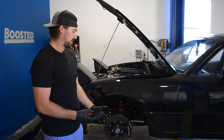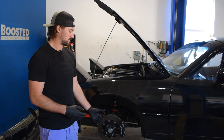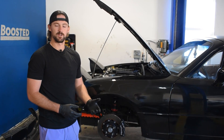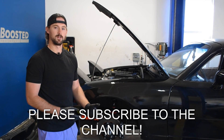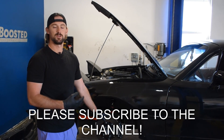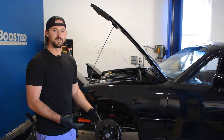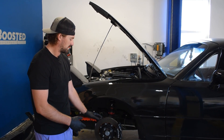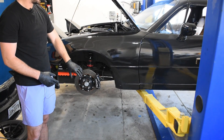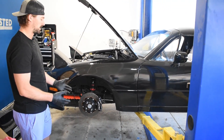In addition to wear, when the wheel spins it now has resistance against it, which is going to create a number of performance-related issues. More importantly, it actually creates additional drag on your transmission, which can be bad for your transmission in the long run. Lastly, as the pads and rotor rub against each other they create heat, which can cause overheating around your rotor and wheel and eventually lead to issues with your wheel bearing. Fixing this is important to minimize maintenance costs going forwards.